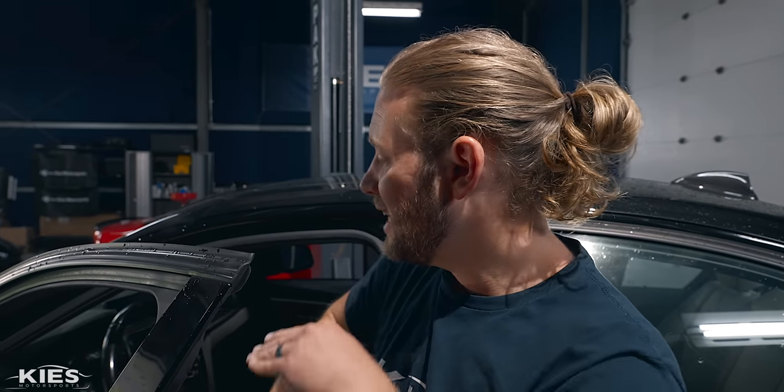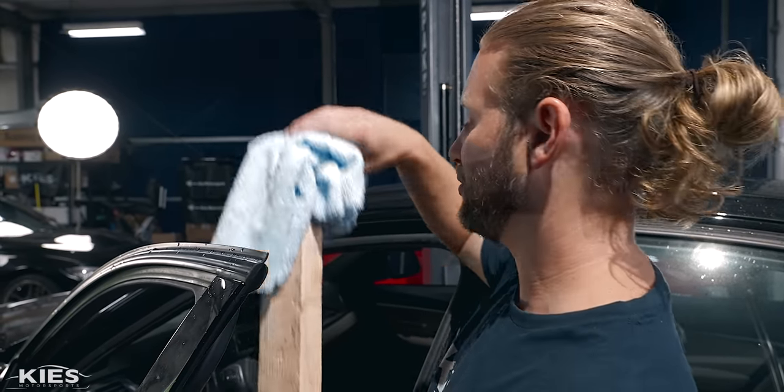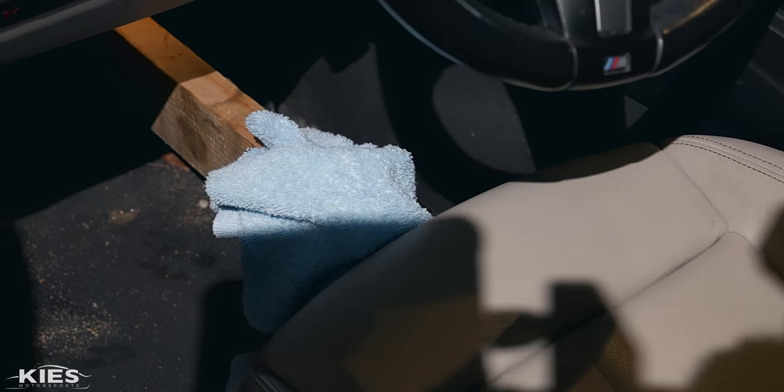The first part of the process is pressing in the brake pedal. I have some microfiber towels over a two-by-four, and I'm going to press it on the brake and then slide Chris's seat up on those towels. What that does is close the valves in the system, so when we take the caliper off, excess air isn't going to get back in. We're going to show you how to bleed at the very end using a Motive bleeder — it'll pressurize the system and force any air out. If you don't do this, you will get air in your lines and need to bleed it over and over again.